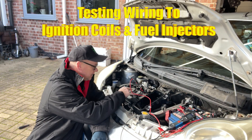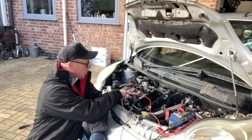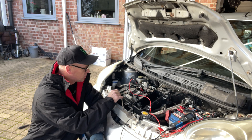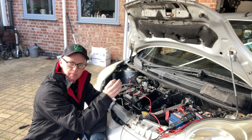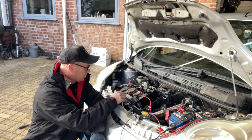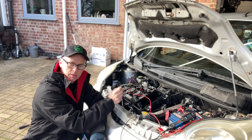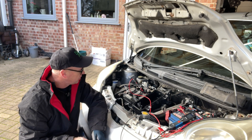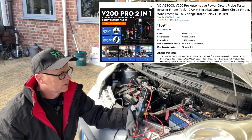I've had a lot of comments about testing electrical components - coils, injectors - and we can test while the engine's running. So if you've got a misfire or something like that, you've obviously checked your spark plugs and you want to check your coil. If you don't seem to have a spark, we can check the switching of the coil on the car using a multimeter.